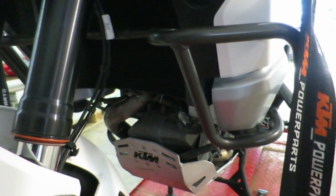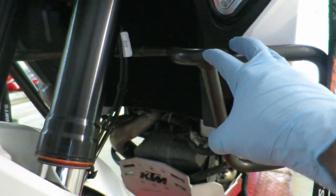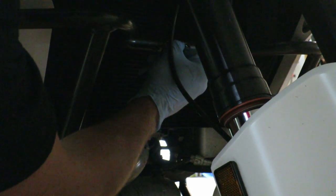According to the service manual, the next thing to do is remove the crash bars. We're going to start with the two screws here in the center. I have no idea why, because almost every other fastener on this bike is Torx, but we do have Allens here — I believe this is a 5 millimeter. We're going to get these removed.